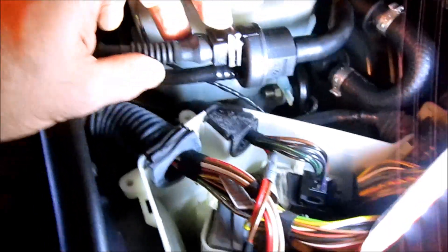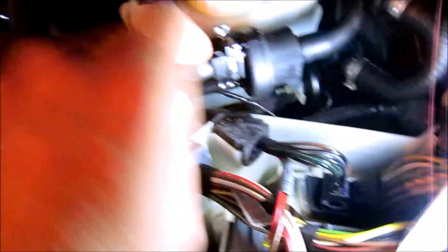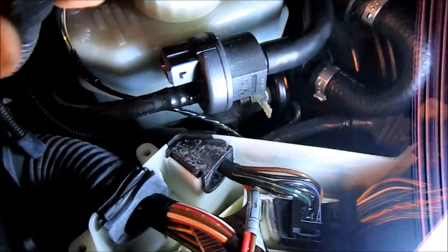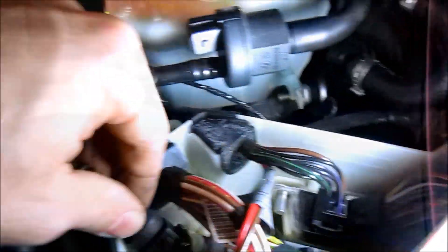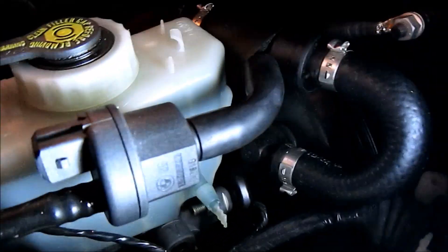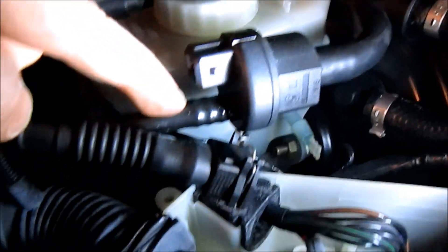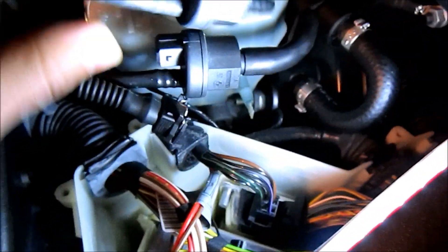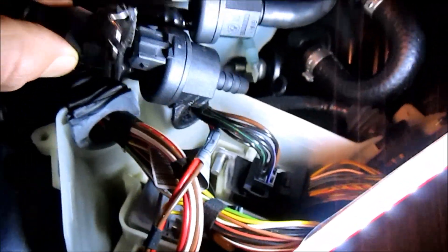When we're working to remove this vacuum line, I would recommend disconnecting this adapter. To remove, push down and pull out and pull away. That might require some force — be careful. This all goes to the master brake cylinder to create a vacuum. This whole unit actually comes out from here, and then you'll plug the adapter back into there.